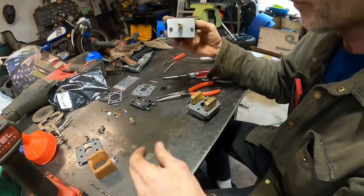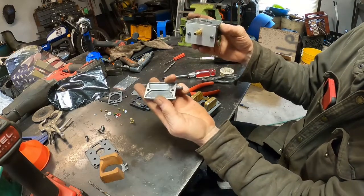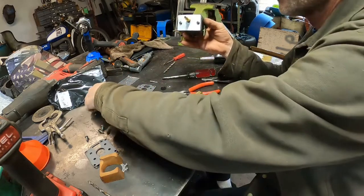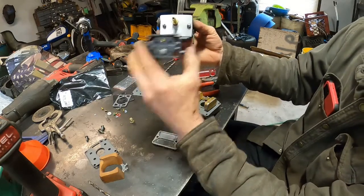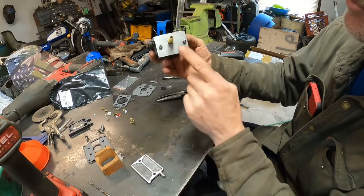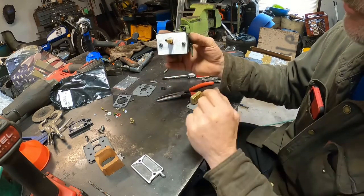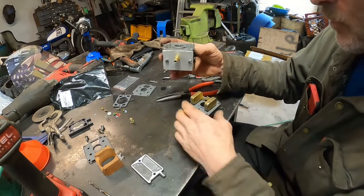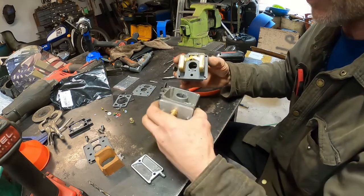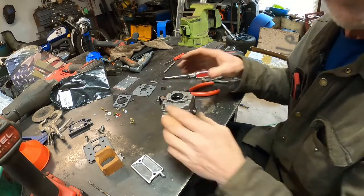and of course this plate I had to make. The old one is very thin, hollowed out, and the inlet goes through the bottom. This was actually made so you could put a fuel pump on there. Here's a fuel pump rebuild kit, but I don't need that on this model because we have a fuel pump on the side of the engine. So this is basically a plate. The fuel came in here and then it went through a chamber and back up through into there. So I just put my inlet there in the top. So we are going to put this thing back together here. Oh, I gotta make a linkage rod yet. That's right, I better go get some stuff to make a linkage rod first.